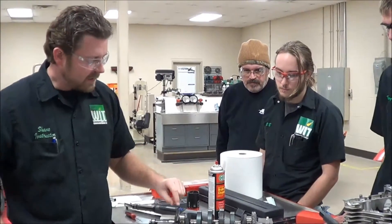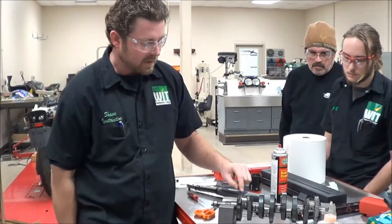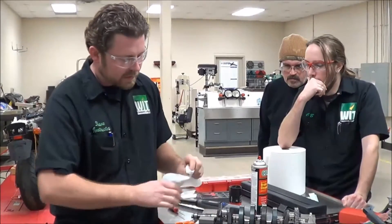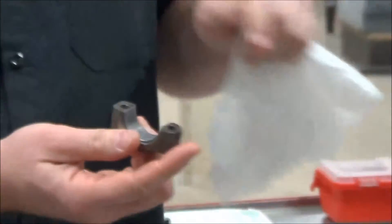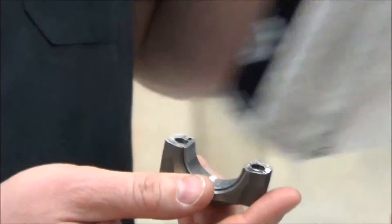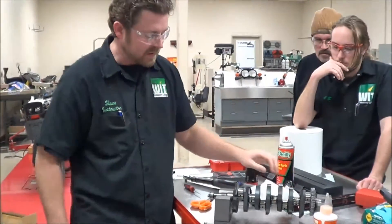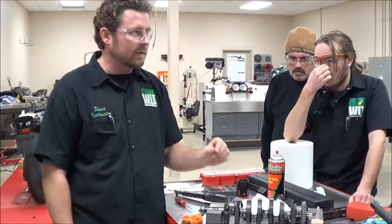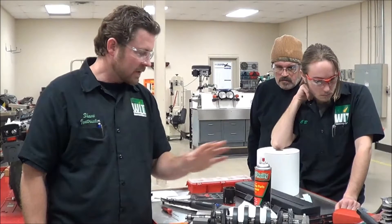I'm going to let my students here go ahead and go through this. This is a requirement — you need to do this to figure out what the clearance is or what that specification is. Then when you go back for final assembly, it's crucial that you clean that off. You don't want to scratch it off and damage it — clean this off with some brake cleaner, get it really good and clean. Think about the part of it that smashed onto the rod as well as on the bearing itself — use brake cleaner, dab along there rather than wiping back and forth. That'll break the plastic gauge up and then you'll be able to clean it off appropriately. Don't use your fingers. On reassembly, use lots of assembly lube. Don't forget you're going to replace your nuts and bolts — that's extremely common on almost every connecting rod that you do not reuse those. We'll talk more in class about stretch on that. So that's your lesson for today.